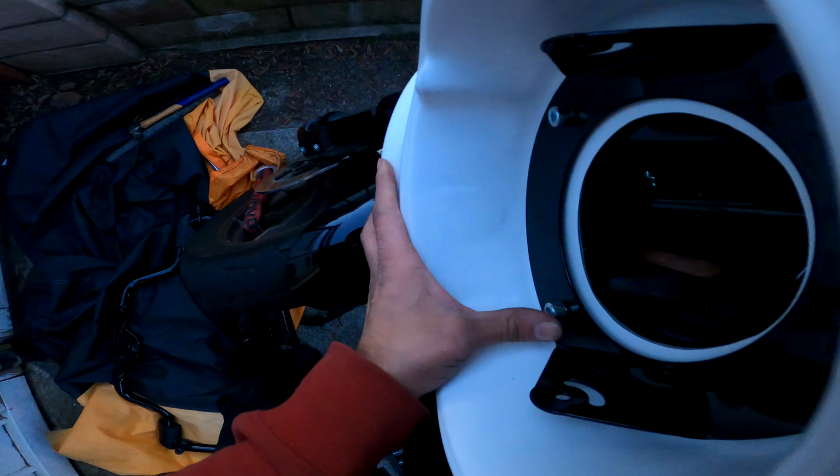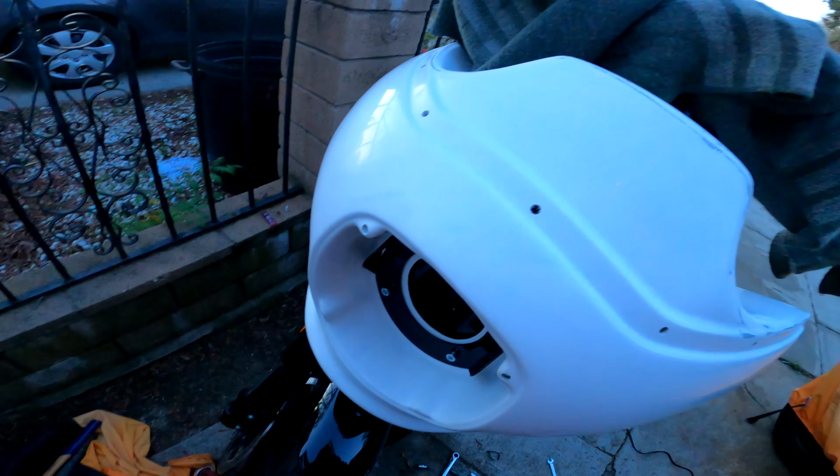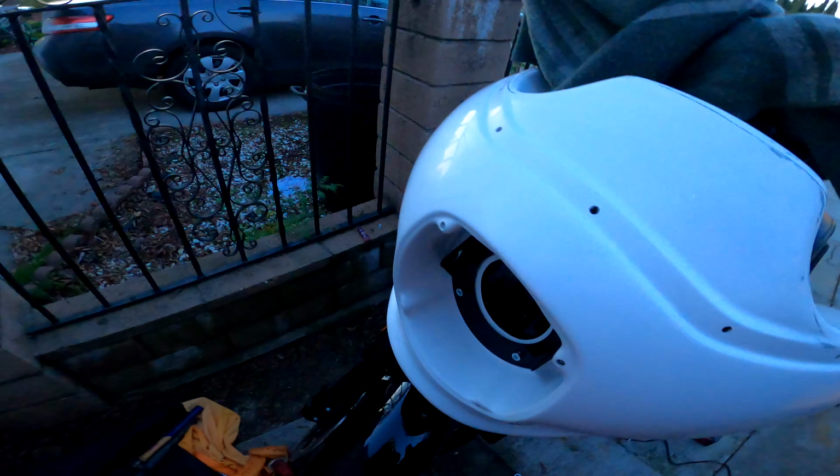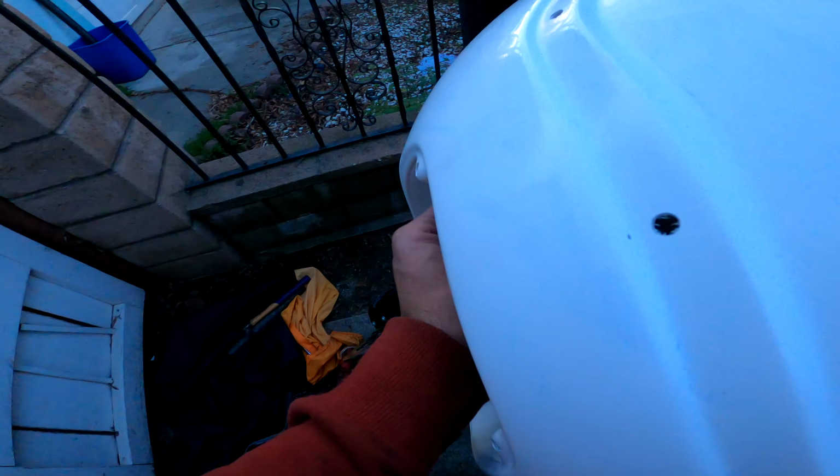So once you have this headlight ring installed and you have it to your liking, now you go back and you use red Loctite on that neck area of the bracket where it's adjustable behind the headlight, and that's pretty much it. Then you go back and apply blue Loctite once you have these parts painted and prepped. Of course, this is just a mock-up, just to get an idea how this is installed. Once you're satisfied with the way it looks, then you go back and apply the red Loctite once you have everything painted and finished.